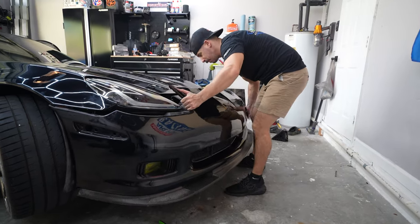Number one bolt is in and already really solid. I need to drill one more hole. I'm prioritizing the top two since they're easier with a shorter screw. She's already really tight with just one. Since I lost the original hardware I went to Home Depot and picked up stainless steel bolts with a lock washer and lock nut — not much vibration here but I want to make sure nothing rattles loose. The rear one is more important to lock-tight since the mufflers move around and could vibrate the screws out.